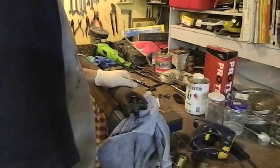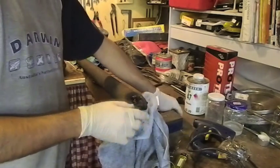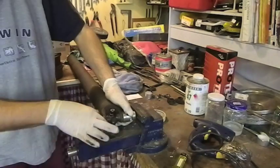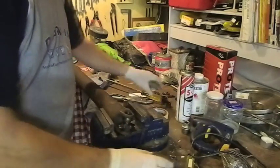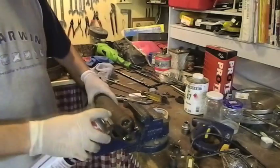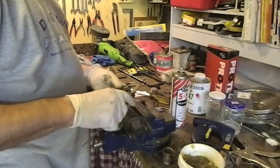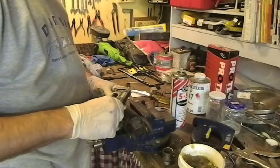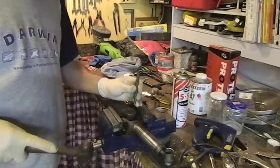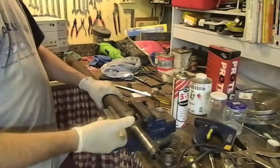Time to start doing a job I don't like doing: replacing universal joints. I'm going to put two new unis in this. They're sort of clipped on from the back behind each one of these, so I'm just going to take these clips off. I've got a rag under there. These are inclined to bounce off. The cap's come off and it really actually is pretty good in there. I've got to push this through back this way to get this cap out, then I can withdraw the uni. But before I do, I'll put a little bit of slip in there first so it should withdraw a little bit easier. I'm going to punch a couple of little marks - two little dots there and two little dots there. That way I can put the yoke back on here without getting it 180 degrees out of phase.